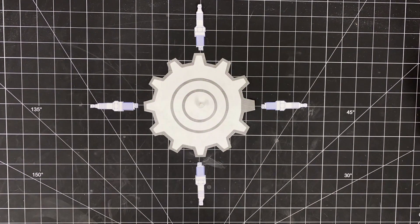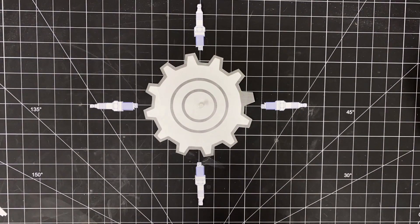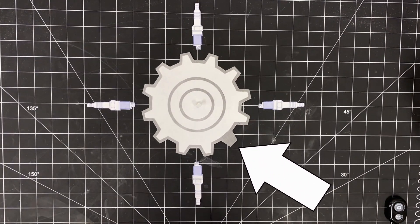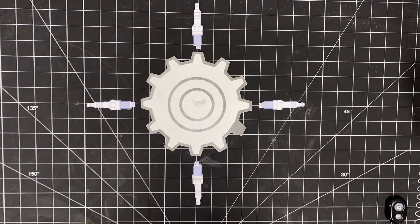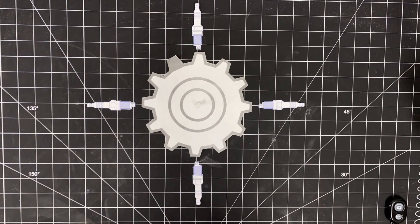Now, there are a multitude of things that can go wrong, but we're keeping it simple. Let's say this spark plug has failed. What that means is the last time combustion occurred was actually way up here. The only thing keeping the engine running at this point is all the momentum built in the rotating crankshaft. This slowing down of the crankshaft is what creates this imbalance condition. The computer on your car can measure the angular velocity of the crankshaft, and it knows which cylinder is misfiring.